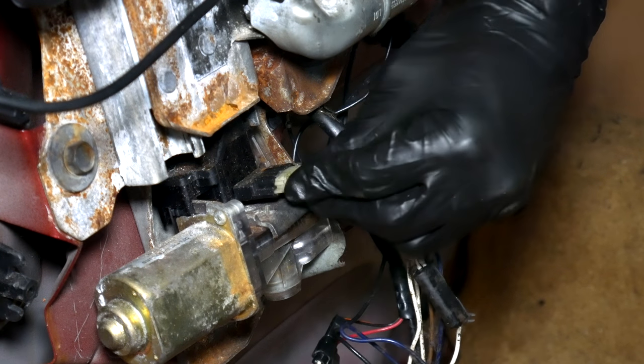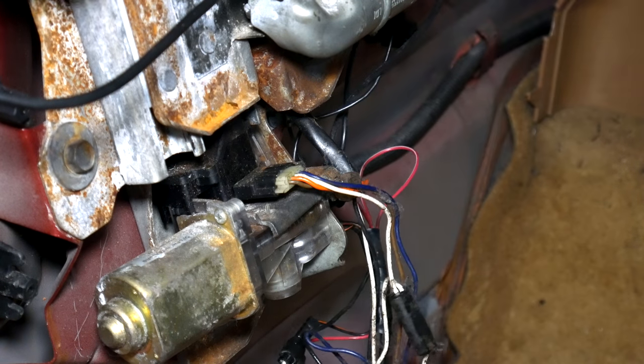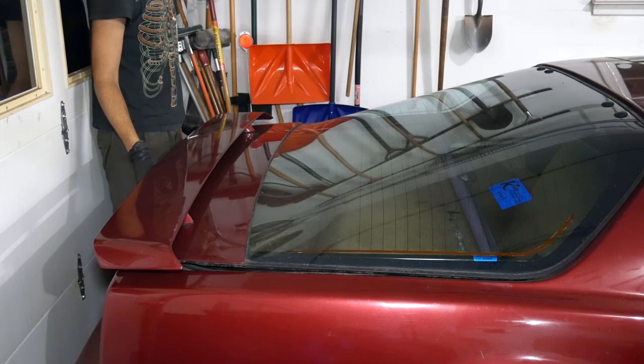There's also a four-pin connector that goes to the motor switch assembly and we'll disconnect that to take a look. We'll use the same file and our dentist picks to clean up those terminals and make sure the contact is going to be good. With the terminals on the switch assembly and in the connector cleaned, we'll apply some more dielectric grease and plug that back in. This connection feels pretty loose, but if it works it works - so for now we're going to leave it and it's time to test our new relay and cleaned-up contacts.